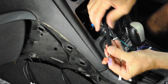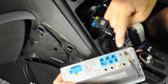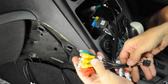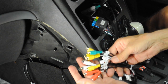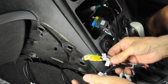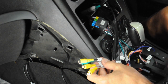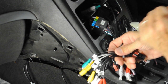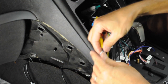Here is the other cable that goes onto the back of the radio — the USB cable. It plugs straight onto the back: USB goes in there, main cable goes in there. If you've got amps, another loom plugs in on the right. This loom has left and right, front and back audio out, and also two composite video outputs, which means you can run them to video screens on the back of the headrests for passengers.